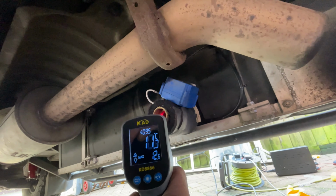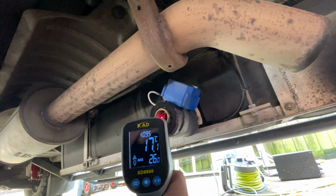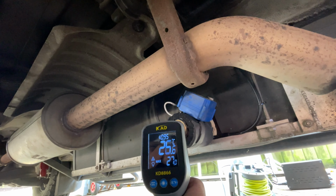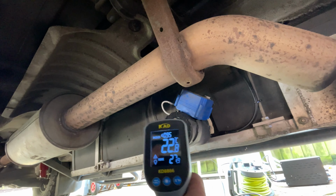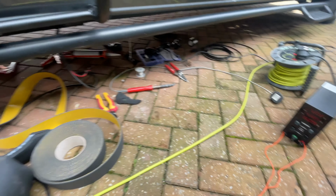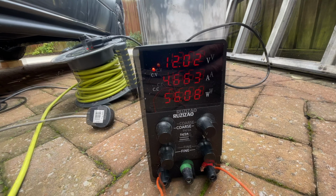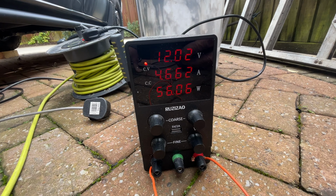7-8 degrees centigrade, but then when I look at the temperature inside the valve, it's getting up to 26-27 degrees centigrade there. So that is going to be absolutely plenty to keep that from freezing. And I've got it just temporarily wired up to this power supply, so you can see that's drawing 4.6 amps and that's heating all of those waste pipes and the drain valve.